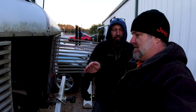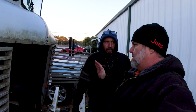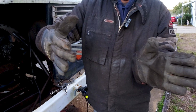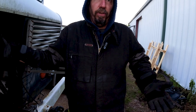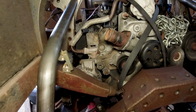So in a dumbed down version, for the Ackerman, the outside tire and the inside tire have to turn at different angles because the outside tire is on the bigger circle. So just picture two motorcycles driving in a circle. The inside guy is going to have to turn more than the outside guy if they're both next to each other like that. All cars just do that. It's automatic. It's built into the geometry when they build it. So since I had to build it, I had to build that into it as well.